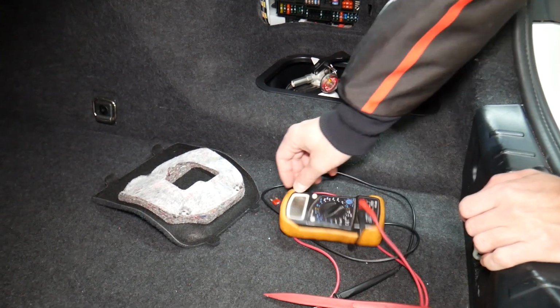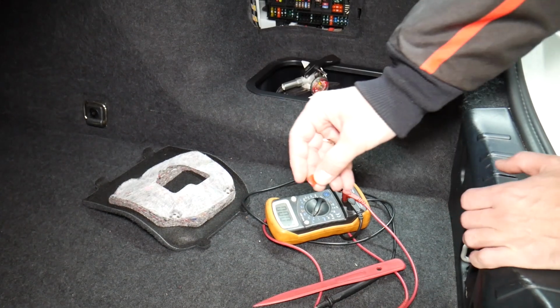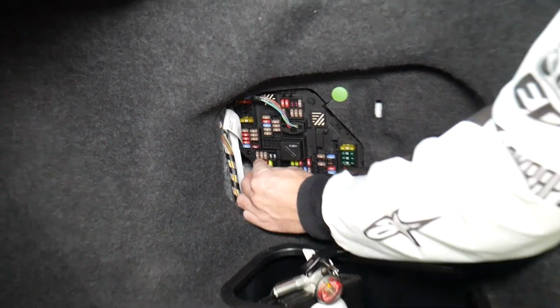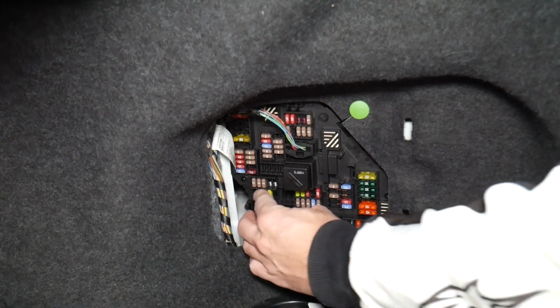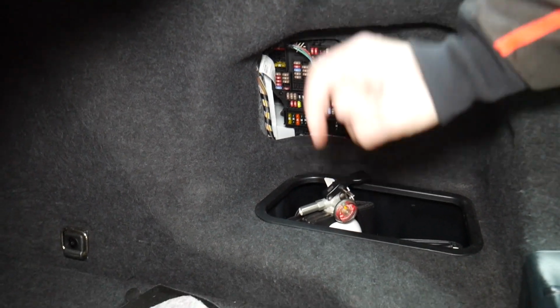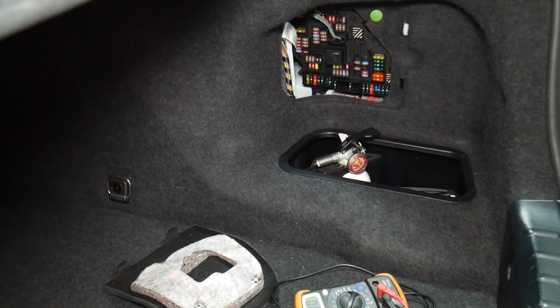So always test your fuses, even if you think it's good, always test it. It even happened to us, and we work on cars all the time. Another thing, always test your relays. They're a little bit harder to test, but if you want to see how to test fuses and relays, we will put a link in the description of the video below.